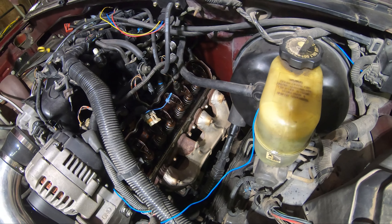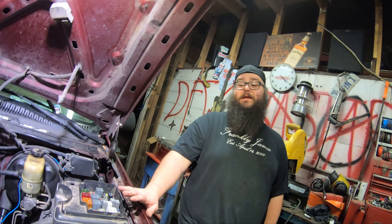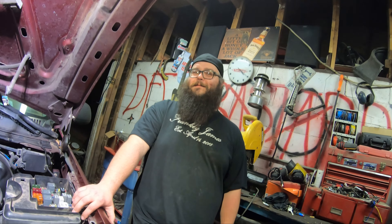I would be willing to bet money that some of the wiring on number five injector is receiving enough resistance to make the injector run leaner than the rest of the cylinders, causing the electrode on that plug to get hot enough to fold over onto itself and melt into the spark plug. With reckless abandon I said it's okay — but I was wrong.